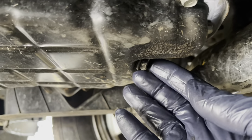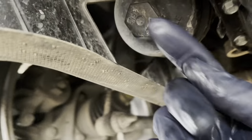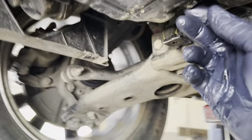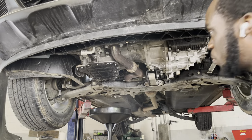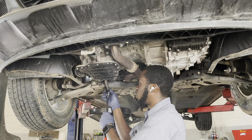So the next step, we're gonna take out this right here. It's gonna be 17 millimeter. And right over here is your oil filter cartridge. This one has a cartridge style filter. So let's go ahead and remove that 17 millimeter. Link will be in the description for the tools, guys, and also for the oil and filter.